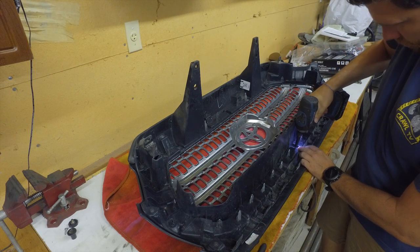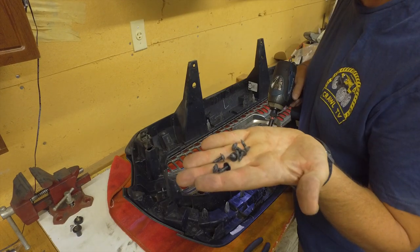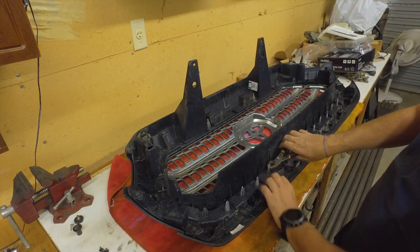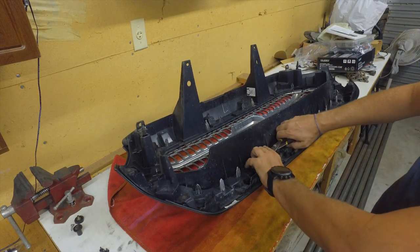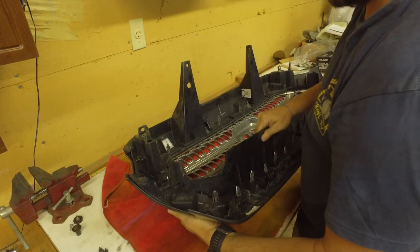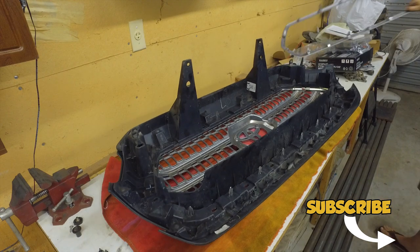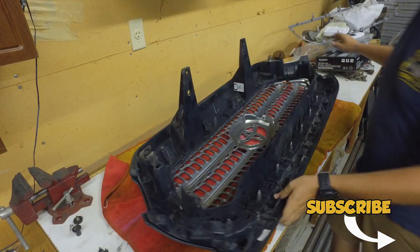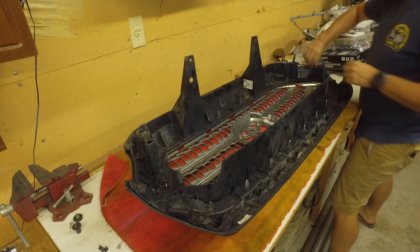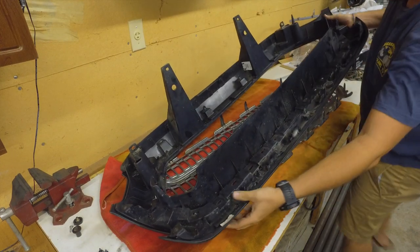I think there's going to be about eight. Let's see: one, two, three, four, five, six, seven, eight. Yep, eight screws that you need to undo, and then all the tabs, and then it should pretty much fall out. To undo the tabs, you kind of just pinch them and push them. It's a sort of a pain in the butt until you get a few going. They are pretty fragile, so don't pinch them too hard because they will break. There we go — trim piece done. Now to remove the rest of the grille, just pull this guy off.